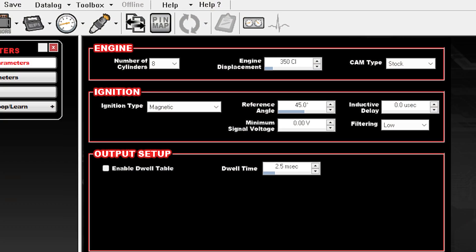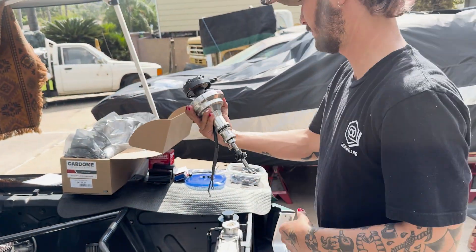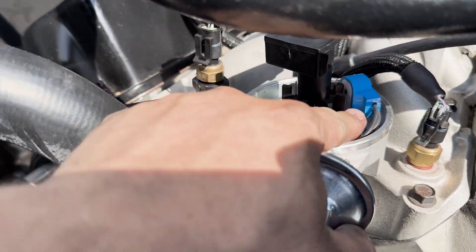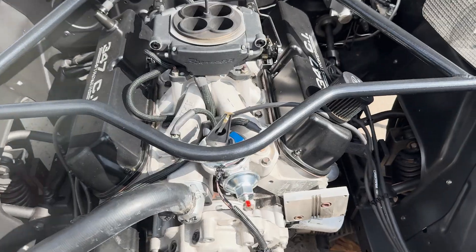In order for this to work correctly, you have to set a reference angle. The way Holley typically sets their stuff up, you provide a reference angle so that pulse from the magnetic pickup happens approximately 45 degrees before the cylinder reaches top dead center. That gives the computer lots of time to react — the computer could react within probably two or three degrees of when it receives the reference signal, allowing it a couple of degrees to charge the coil and fire it.